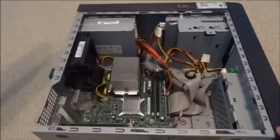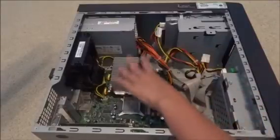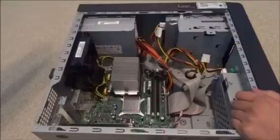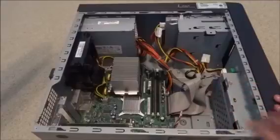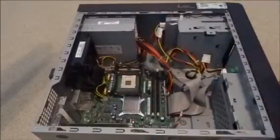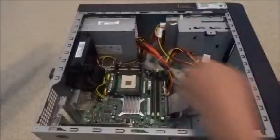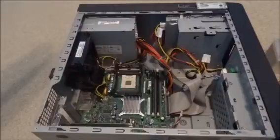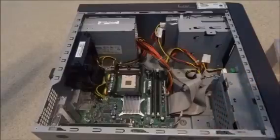There's no screwed-on heat sink. In fact, the heat sink is actually what we're going to do first. Now, these older series Dell heat sinks tend to want to take the processor with them when you remove them. So don't be too surprised if it comes with you if you're following along with this upgrade. Hopefully it won't happen to us — oh, and look at that. There's a little processor attached to the heat sink there, and an empty socket. That's not good. But what is good is that it looks like none of the pins are bent.